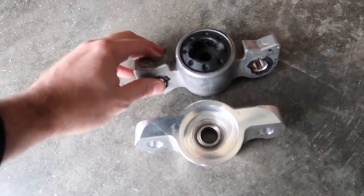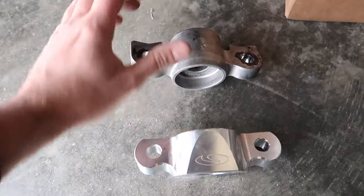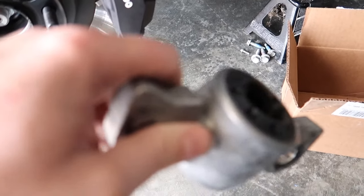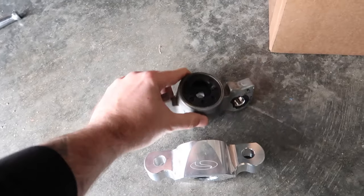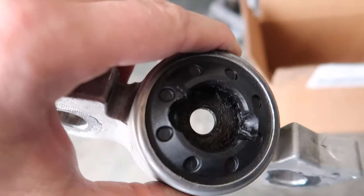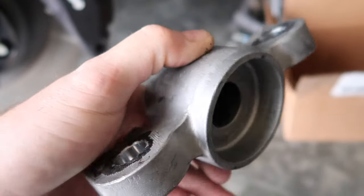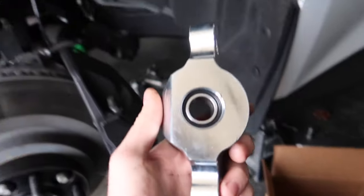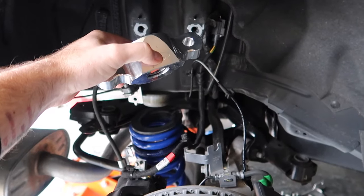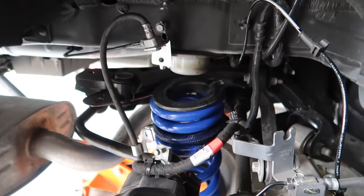Side by side, here's what they look like. This piece from Ford isn't really that bad, but if you're going to go to the 12-millimeter-shafted adjustable shocks, you're probably going to want to get the billet replacement. That way you don't have to drill out the hole since it's wider. It took about 30 minutes each side to drill through, and it got so hot the rubber just fell apart. With the new piece there's nothing in there to fail, which should be the answer to our clunking problem. We're going to slide it right up in there.